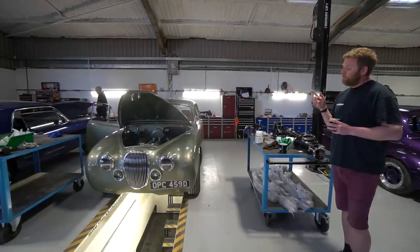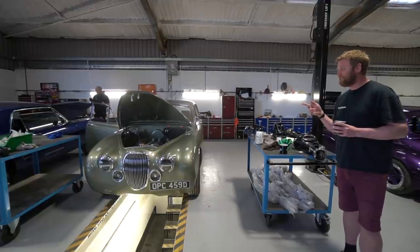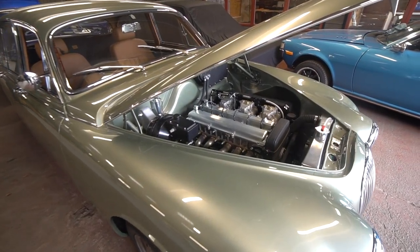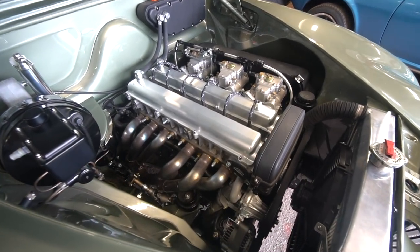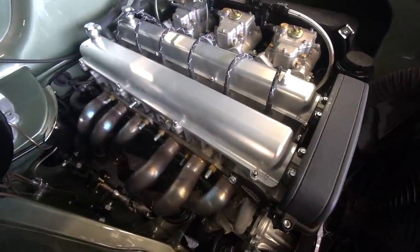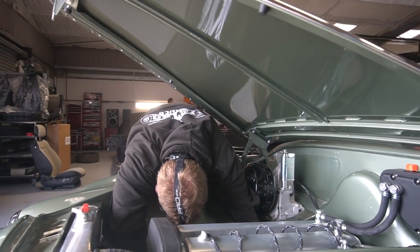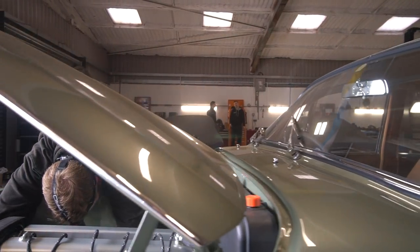So it was essentially the push rod that came with the first master cylinder — and this is a note for those buying Mark II Jag master cylinders. It had a neck-down section and a sort of spacer washer with a slot in the side. The spacing on those cylinders is completely wrong — it doesn't allow the piston to retract far enough to let fluid back into the master cylinder when you release it. The new one had a captive machined washer with a really nice machined ball socket on it, and the shaft of the push rod was properly machined, whereas the old one just looked like a pressing with a vague semblance of a ball socket. Got to the bottom of that — working second time around.